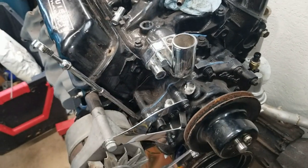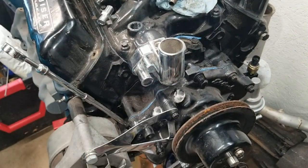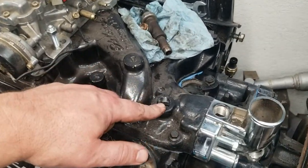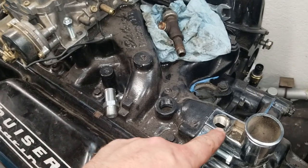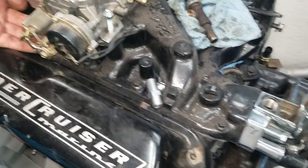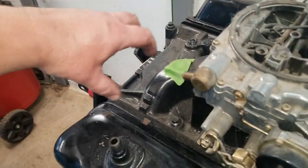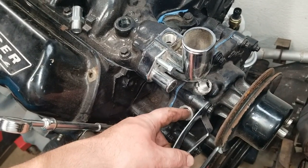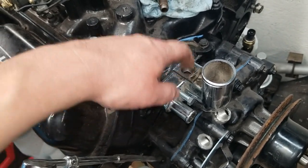And when I look up, I'm trying to design this engine for early 60s Mustang. That's what this bracket is. The water pump is supposed to fit on there. Dipstick. So apparently, back in the day, they ran the heater hose to here with like a 90 degree fitting. I got one of those, but this is like way bigger hole than they did back then. It's actually like this size. But I did find one that'll fit in there. And they ran the hoses under the carburetor, along the valve cover. And on a Pinto, the hoses come out right above it in that area, so I think that'll work fine. Route the two hoses under here. One will go here. God, my camera skills are lacking. And one goes here. I think the new one has their one there, but we'll have to plug that.